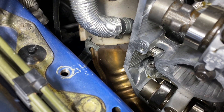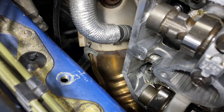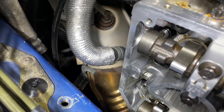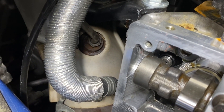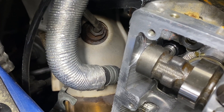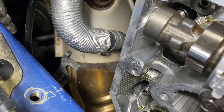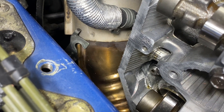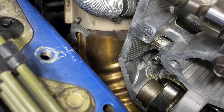I have that lower half moon installed — it's a totally smooth transition, completely installed all the way. That's the lower half moon for the exhaust cam, and moving up to the intake cam, that's the little half moon behind the intake cam. Those half moons are completely installed with a nice, smooth, flush fit with the top of that cylinder head surface. Now I can go ahead and install those valve cover gaskets, putting a little bit of RTV on them just like factory specs. This should be a lot more robust sealing for those valve cover gaskets over the long term.